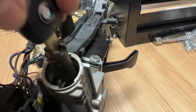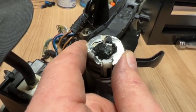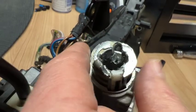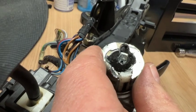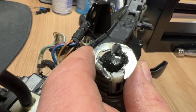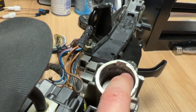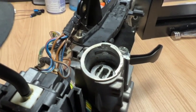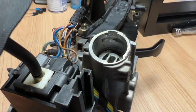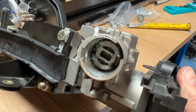First you can get the centre of the barrel out by inserting the key, then the barrel comes out of this section. I simply drilled down at an angle — it's all very soft metal, aluminium or similar — and it released the bit of metal in the slot enough for it to fall out. All three columns are now done using that method.